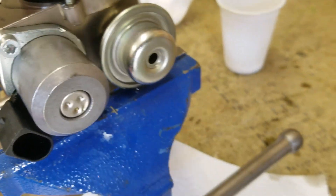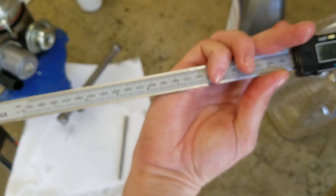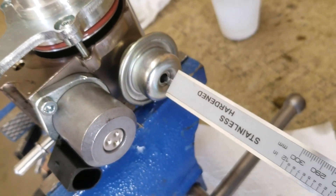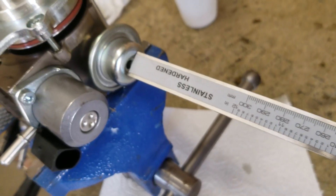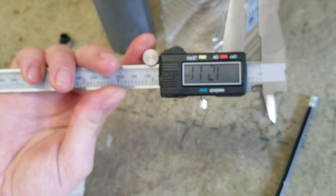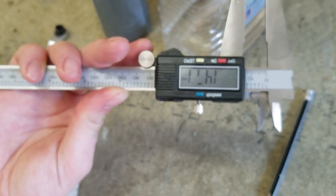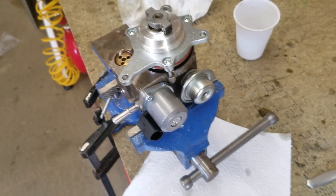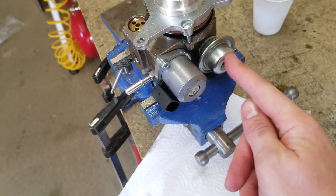When the pump is good, you should be able to take your digital calipers and use the depth gauge part — put it in here very gently, not to damage the diaphragm. The depth of a good pump at room temperature should be no more than around 20 millimetres. This pump, when it was brand new, had a depth of 13 millimetres measured from the outside ring here.